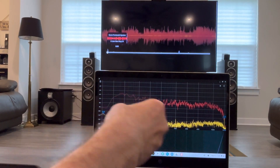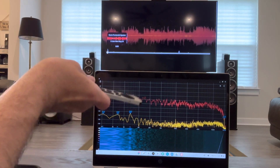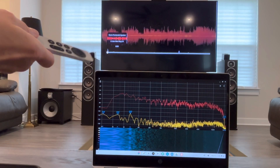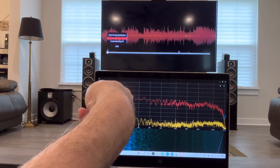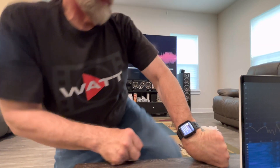So we've established this is how it's set up right now — this was done months ago. I did the auto-calibration through the receiver. What you're seeing here is basically the left and right speakers only and the subwoofer. The subwoofer is connected to the LFE jack, the sub-out on the receiver, and the tower speakers are hooked up to the left and right. This is an image of what's going on right now — definitely a little bass heavy, which kind of surprises me. This setting is called Pure Flat.